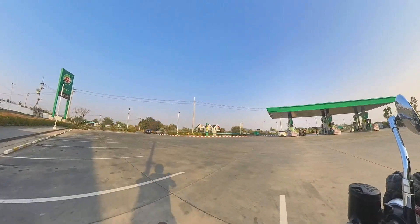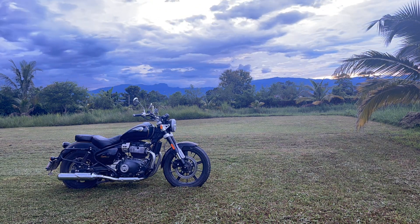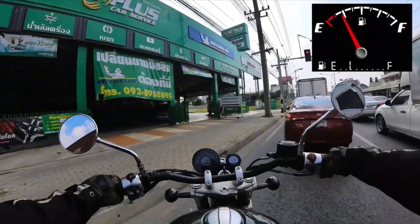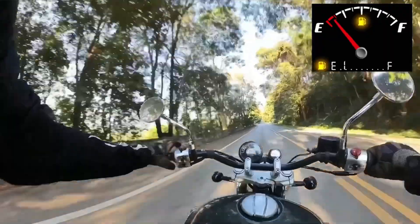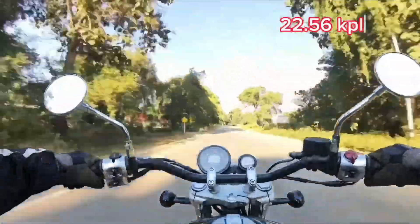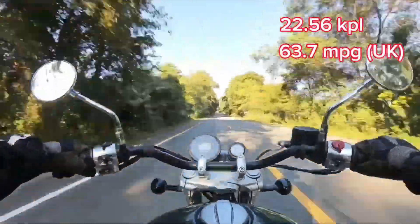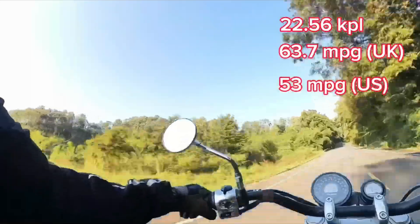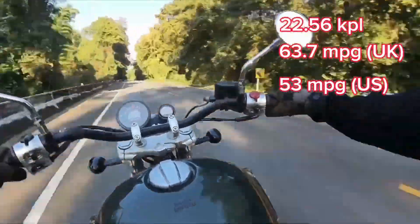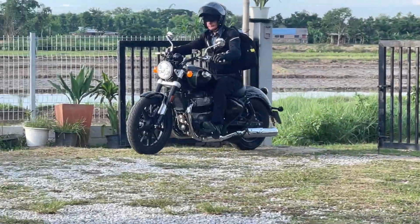I've just refueled and I've got some figures worked out. Here's some old footage from one of my first rides — my maiden 1,600 kilometer voyage to Bangkok and back, still on the chain with a brand new bike. Bearing in mind it was city traffic, motorway traffic, and mountain roads. The average consumption was 22.56 kilometers per liter — 63.7 miles per UK gallon or 53 miles per US gallon. For a big bike I think this was fairly good, and please bear in mind this is a new, tight engine. As it loosened up I certainly did get better MPG. On the chain eventually I averaged 24 kilometers per liter.